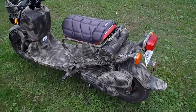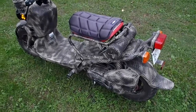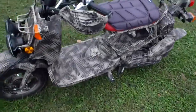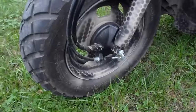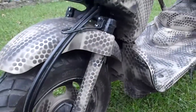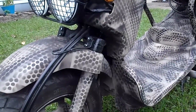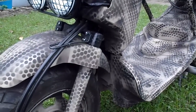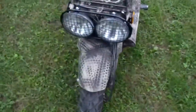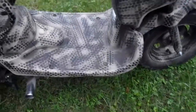Some updates for the 2015 Honda Ruckus: did a full camo paint job on the Ruckus, made my own pattern, came out really good. Even did the wheels — they came out really decent. Left it in a flat paint, no clear coat. Don't like clear coat; if the paint gets chipped, damaged, or scratched in any way, it's really easy to just wet sand it and paint right over it to keep that camo pattern. It was really easy to do.